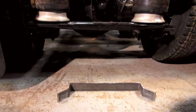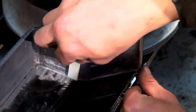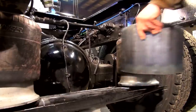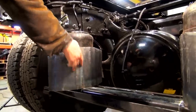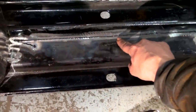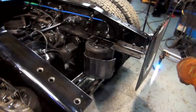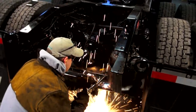Now we'll be modifying the rear airbag shelf so the ZAK-Lift can step further towards the rear end of your truck. We've pre-manufactured a template and we'll be scribing that onto the rear airbag shelf — this will give us an indication of where we need to cut. We're protecting our airbags because we're running an oxy-acetylene torch. We'll be removing about a four to five inch section, and you want this to be about 18 inches wide to accommodate the ZAK-Lift.